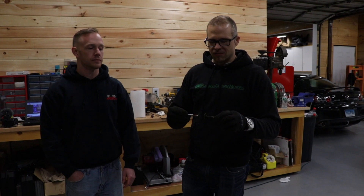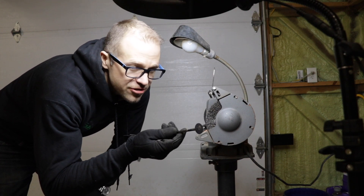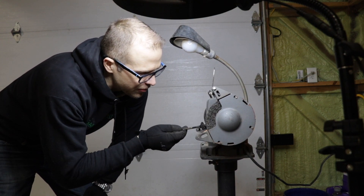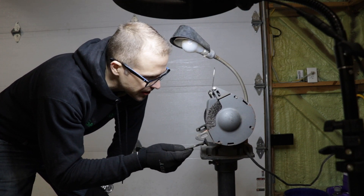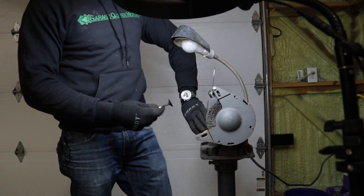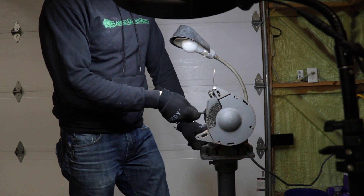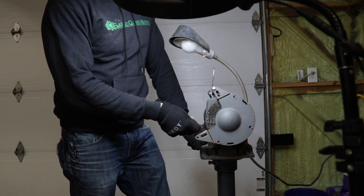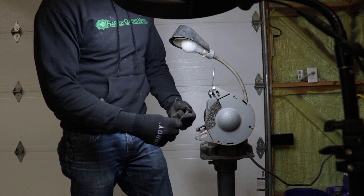Can you explain lapping a little bit? It's like when you're driving around a track repeatedly. We'll talk about lapping once we get to it. So we are actually going to use a bench grinder with a wire wheel on it to clean the carbon off so Ryan doesn't have to sit here for a week with his little hand brush. Thank God. You've got to be careful with this because it's going to want to grab the valve and jam it down underneath here.